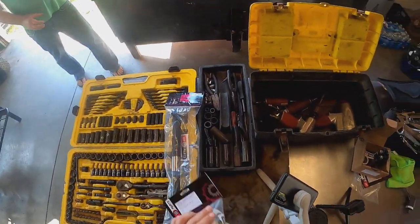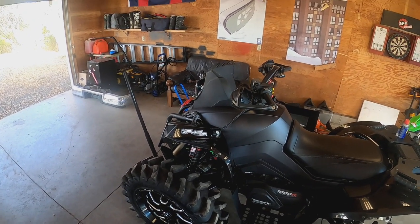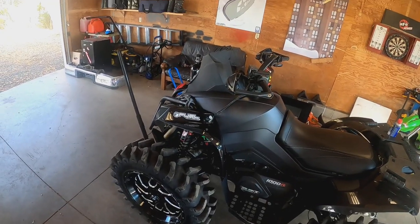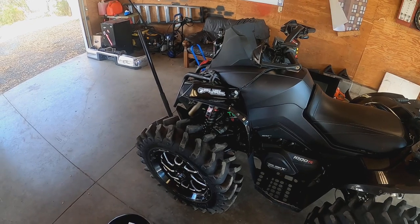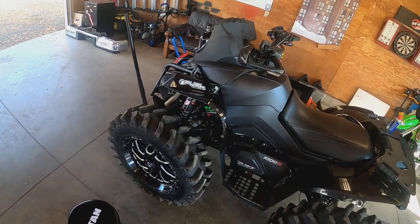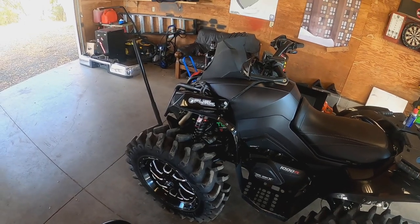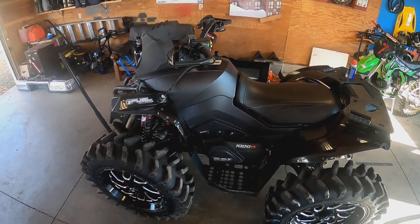Kick ass. I'm gonna want to disconnect the battery here. Definitely, because I've got enough wiring in the way to play with. We're not gonna want that to be an issue. Yank the seat off, get the plastics off, front tires off, inner plastics, disconnect my rock lights, get those removed and out of the way, make as much room up top to get at the airbox. Then maybe I'll bring you guys back in at that point, or at least when we start pulling the horn and stuff like that. But I'm clearing things out of the way.